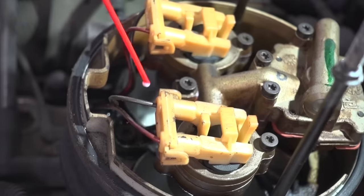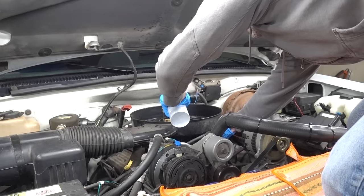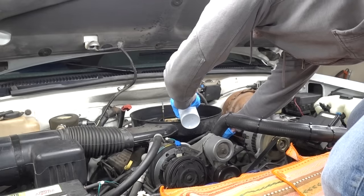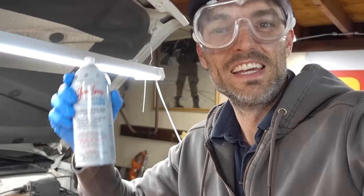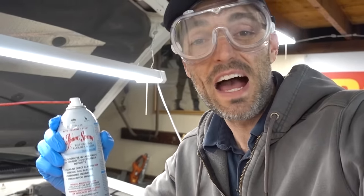I can really feel the motor shaking a little bit. We're gonna call this Operation Just Get Smoke. This bottle is empty. I'm gonna shut the car off now, and we're gonna let it sit for 5 to 15 minutes. The hot soak is now over. The truck has been sitting for about 15 minutes. Now we can start it up and look for that elusive smoke.